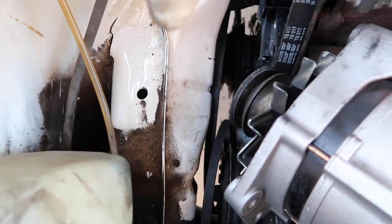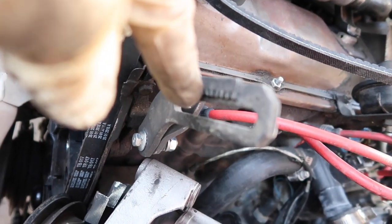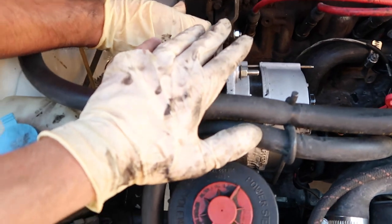He is working on the pulleys down there with the crankshaft while I am installing the alternator. We have the pulley for the alternator here — there's a bolt with teeth that raises or lowers your alternator. I have the wires down here color-coded: we have our ground and there are two electric wires — all those are matched up. I'm going to tighten this up, put the pulley cable back on, tighten it, and the alternator will be installed.